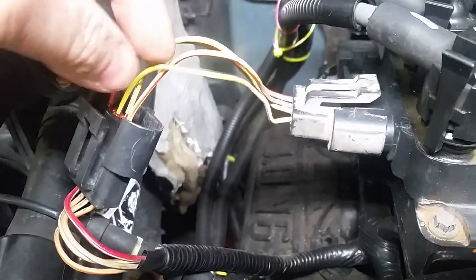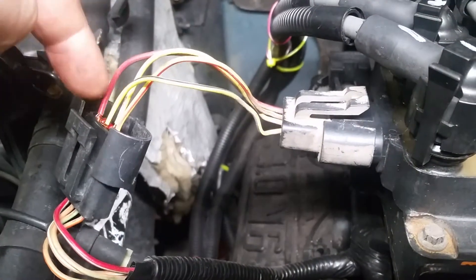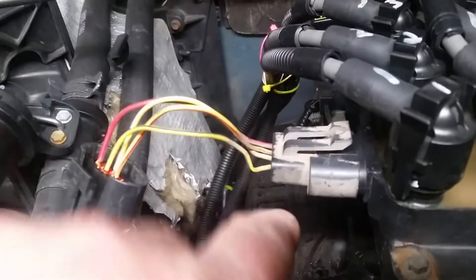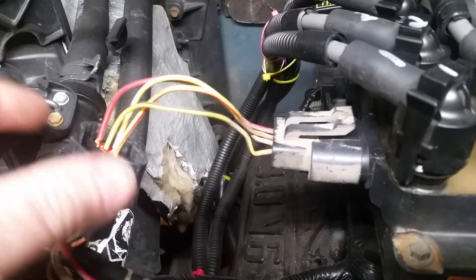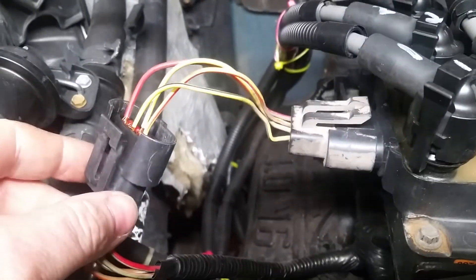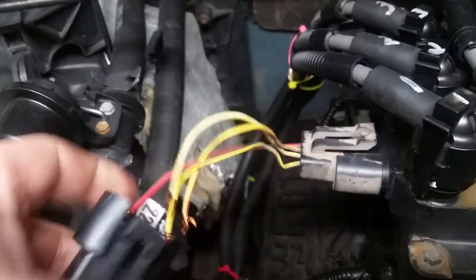The bottom will show you — each round bulge is a coil supplying each set of plug wires, so it's really only three coils. Since the positive is on the far left on the Explorer and on the far right on the Ranger, it doesn't matter as long as this set fires first, then that set, then that set. The reason I have number one closest to me going to the red wire is because the front bank is the one that's got to fire first.